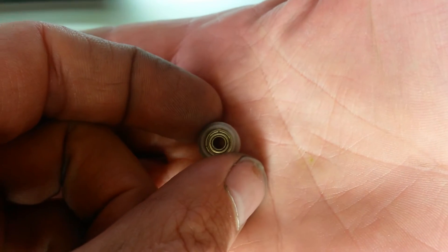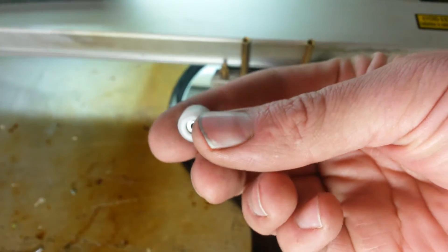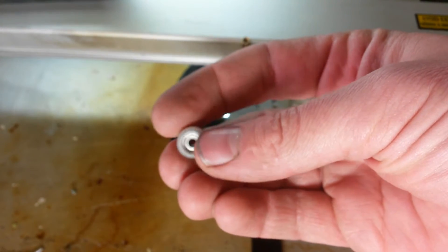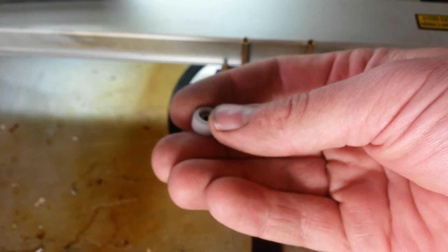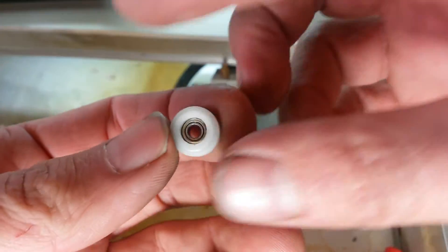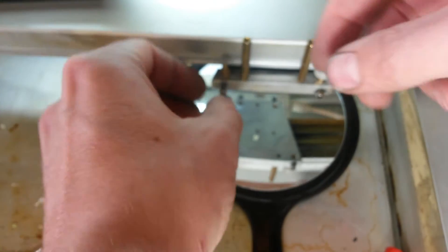It's actually ball bearing — it does have a bearing in the middle, which is good. You don't need to worry about putting grease, white lithium oil, or any kind of oil on there because it is a ball bearing. Your oil is not really going to be doing anything. It is a sealed bearing, so don't worry about that.